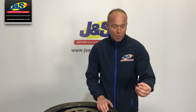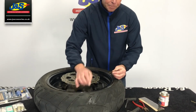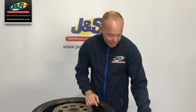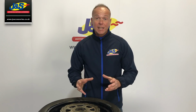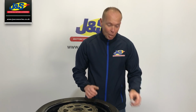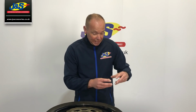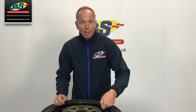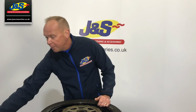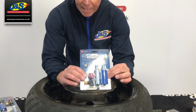Some kits don't come with a blade to trim off the excess. Okay, so I just carry a blade in my little kit. So essentially, if you're buying one of the more basic kits, some useful add-ons would be side cutters and a blade. And then also something to re-inflate the tyre, whether it be a little 12-volt pump that you put on your bike battery, which you can buy, electric pump, you can use one of those, or whether it be simply the inflator kits on their own.